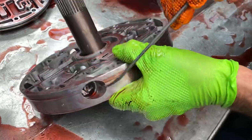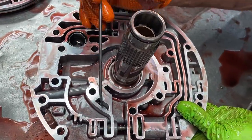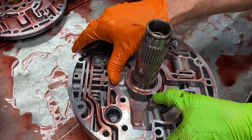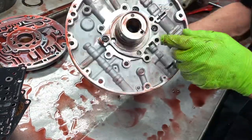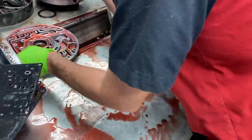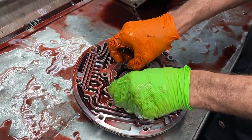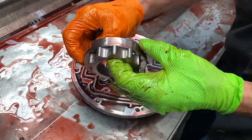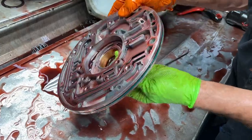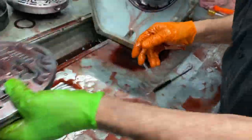The shift kit will also come with a new boost valve assembly that goes in here. Just pay attention - look at your valve here too, make sure it's got good bluing, ain't pitting on the edges and stuff like that. You want to look here where your pump gears run on both sides - it looks really nice, all that is just like a stain up in there. Just remember your bushings - this one's just spiraled down, this has a hoop bushing. You've got Teflon sealing rings here. And then you want to look at your pump gears. Now this thing has a lot of metal in it, so we're really going to be looking at the body and stuff like that through here. See all that scarring in there? We'll actually have to put a body in this - this cheesed up pretty good on some gears. The stator looks good - we can just come in here and replace this piece here and get back to having a nice pump.